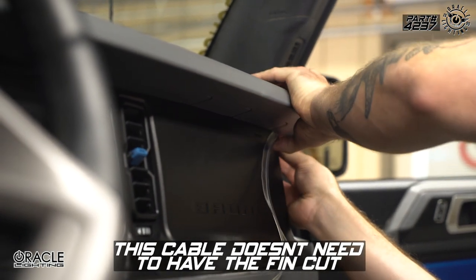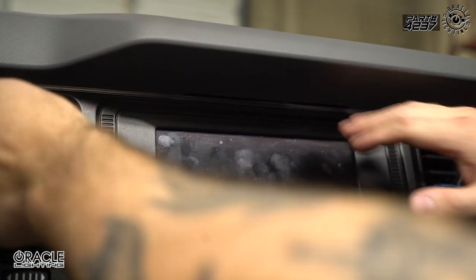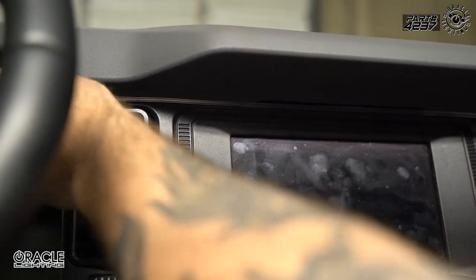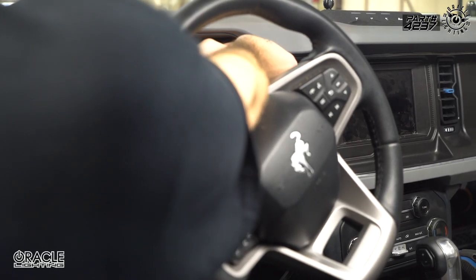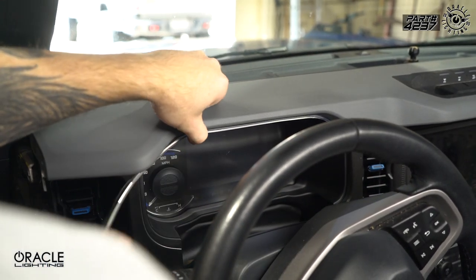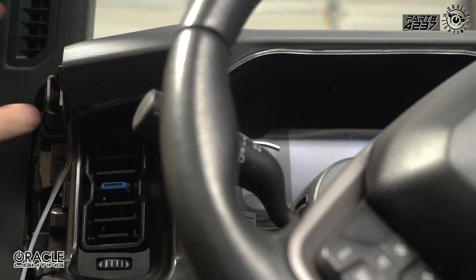We cut a nine foot piece — make sure that we have the same distance of cable on the edges to meet the other side. This one's going to be higher. One thing to point out is that there is a slightly larger gap where the screen is, so you want to make sure you have enough tension on the cable where it fits snug — that's going to keep it from sagging or being pushed too far up. Now we're just going to continue around the instrument cluster and get that tucked in.